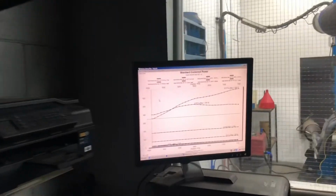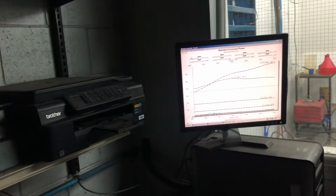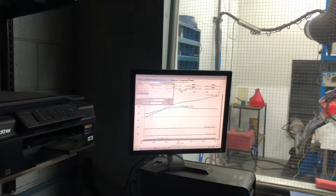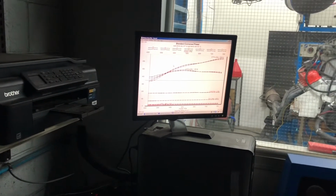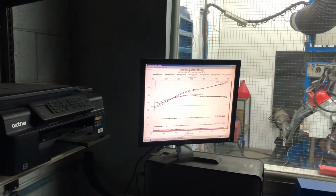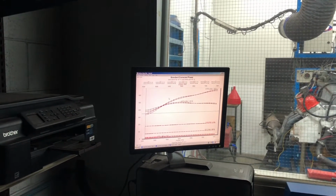Yeah. Hey, it gained again, like another 10. And it's actually climbing harder at the top. And it made way more torque. Look, we gained almost 15 foot-pounds. Last time at the top of the graph, it was pitching off, see? This time it's still climbing. But it liked it. So what the fuck? Now we're in a moral dilemma. I mean, it was a smaller gain that time, but we could add another 2 degrees and try it again.